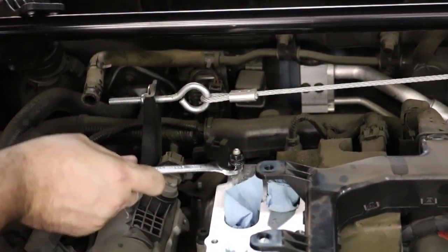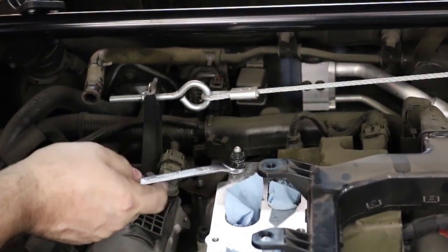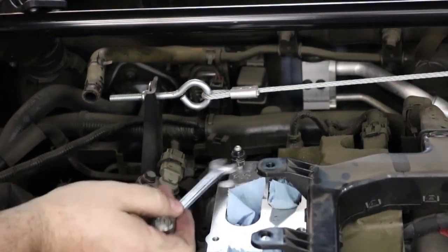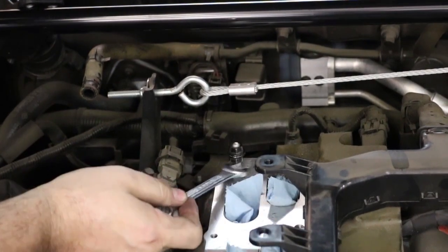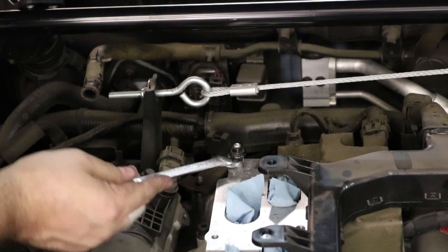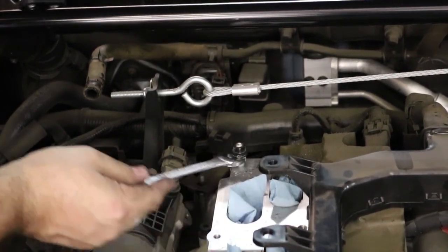So this is the safest method, using the vice grips if you have to. Usually it works if you use heat and, you know, PB Blaster and the vice grips are big enough and tight enough, but sometimes the studs are just so stuck in there that you end up ruining the stud and now you got this stud stuck in your lower manifold.